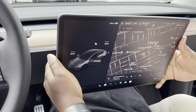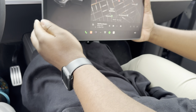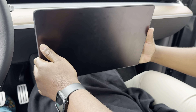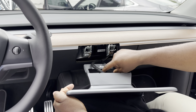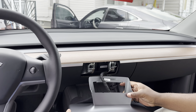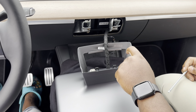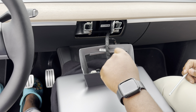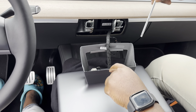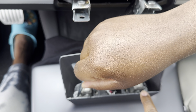When you take the screen out, put a microfiber cloth down to protect it from damage or scratches. Lay it face up. Now with the screen out and face down, the next step is to unscrew the two hexagon screws at the bottom, which will release this piece. There are two screws you have to remove.